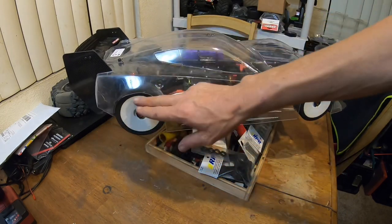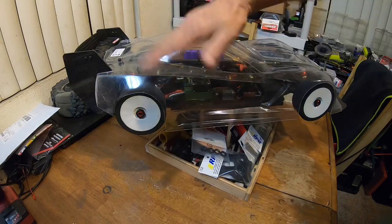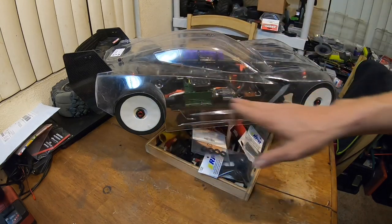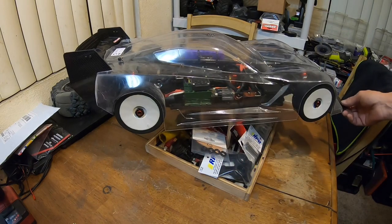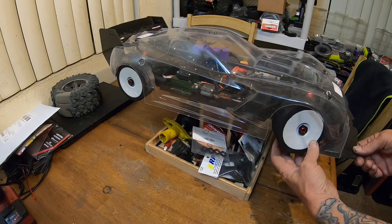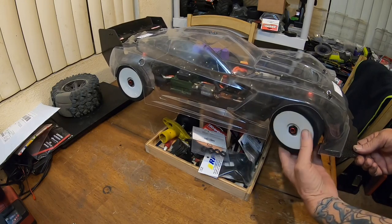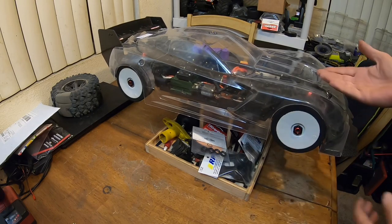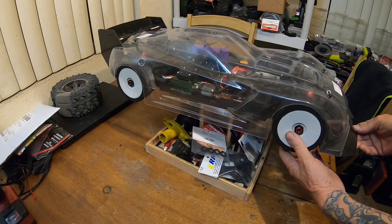Right now, I have the rear lower than the front as far as the body mounting. Now, my chassis is raked forward. And the reason I have it that way is for a turning radius. So I did notice with my suspension up, my droop, I clear perfectly.